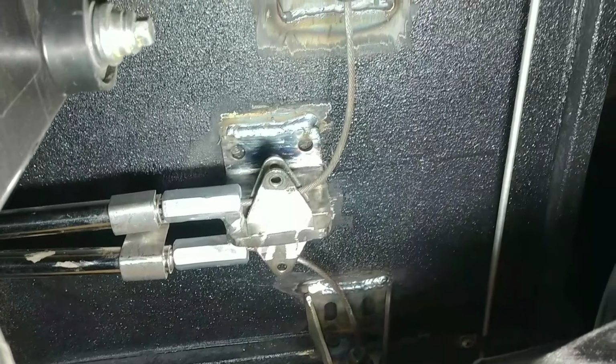That's my emergency cable apparatus that I put together. Those are emergency brake cables off of a '56 Chevy rear end, which instead of getting new ones, I just went ahead and added this bracket here and here, and then put that bracket together. And yeah, you'll see when it's finished, I have a couple of pulleys that go inside that bracket.